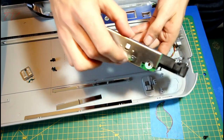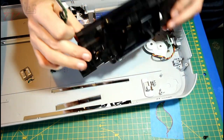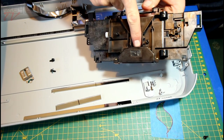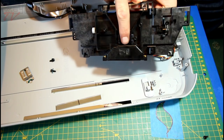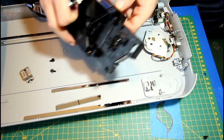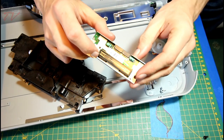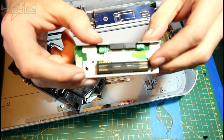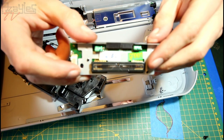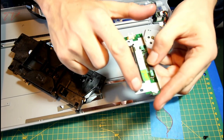Right, so got this off. What it looks like inside. Final lens, final optical path rather, of that mirror into that little gap. Can you just about see it? Probably if I do that. There it is, kind of. And that light goes onto here. And this is a one dimensional sensor. In fact, I can't get it to focus still. Is that focusing? Probably a little bit. But you basically got a strip of light sensitive pixels inside here.